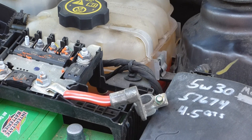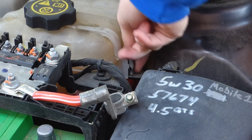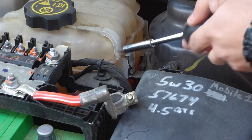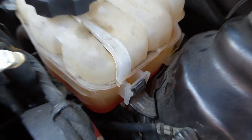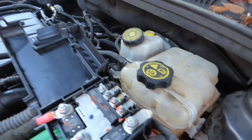The next step is to take this clip off of the front of the reservoir — it's keeping it held on. Sometimes it helps to use a screwdriver. That's where the clip came off, and right back there you see that little plastic tab that needs to slide forward. This whole reservoir needs to slide forward towards the battery, and then we'll start disconnecting lines.